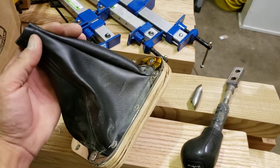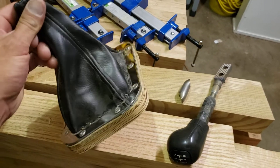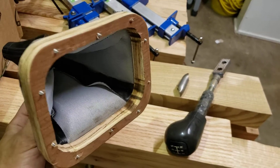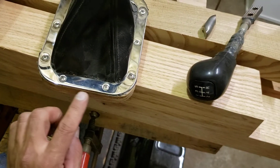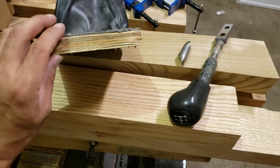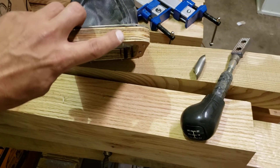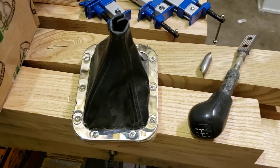Then I got this boot — this is a boot for a regular Fox body Mustang. I got this boot from Summit Racing and a little ring that came with it, and I cut out this plywood ring that I'm gonna make like a form to the transmission tunnel, because it's got a pretty rounded edge and it's not gonna really support this flange. So I'm gonna belt sand this out, shorten these screws up, and fit that to the 240 next.